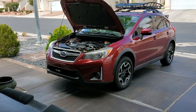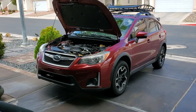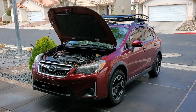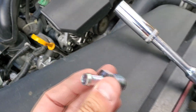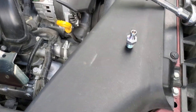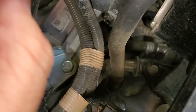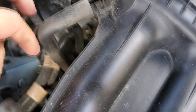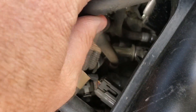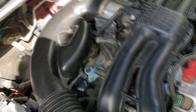And then I'm going to come back and we're going to change out that PCV valve on this, for anybody that wants to watch me do it — on the Subaru. Okay, what a good day. For the PCV valve, that's what it looks like. It's a 19 millimeter socket. Basically you can just follow this hose down and it's just down there. We'll just pull this off and pull it out, get our extension down in there, and be able to just take it out. That's all it really is — just replacing that.